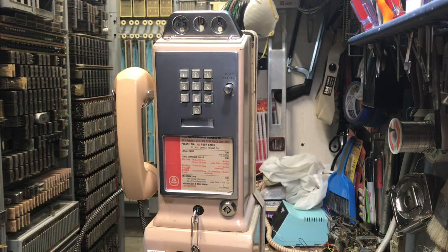This concludes the video for the Western Electric 1234G. These phones go for at least a thousand dollars and up, and there are very few of them out there. This was when touch tone was in the very early stages of being deployed, so you would only find these in areas that had a Number 1 Crossbar with touch tone, a Number 5 Crossbar switching system with touch tone, or a very early Number 1 ESS switching machine.